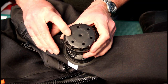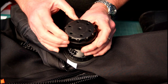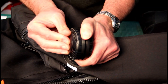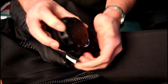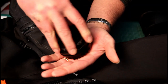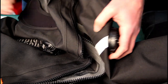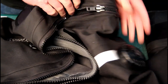A little bit more involved is the shoulder dump valve. As stated on the inside of the valve, the locking nut says to fit and remove: depress the dump valve. That means you've got to press it down — did you hear that little click? When you tighten it, it's important that you press down first and then tighten, because if you don't, it can go on the ratchet and ruin the mechanism of the dump valve.